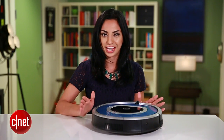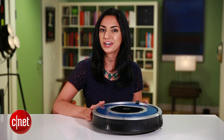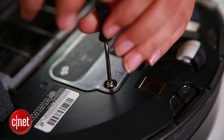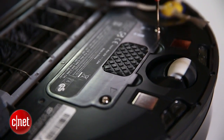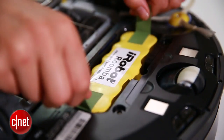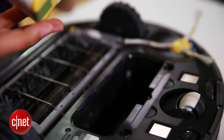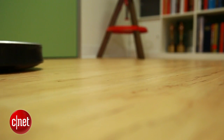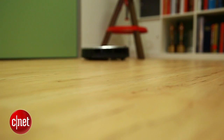If you're going away on vacation, put your Roomba in what I like to call vacation mode. That means charging the battery completely, then removing it. To do that, just flip it over, unscrew the battery door, and lift. When you get back, recharge the Roomba to full and then run it until it dies, then go back to your regular routine.